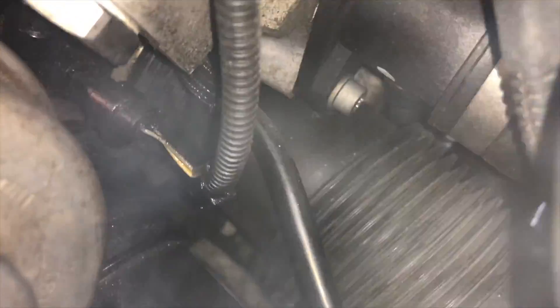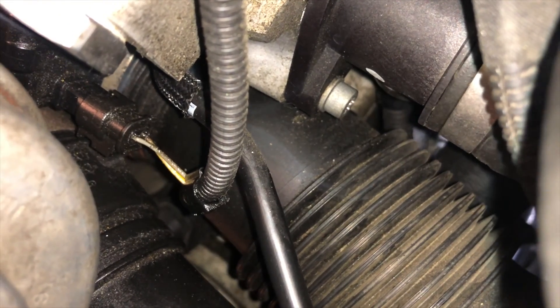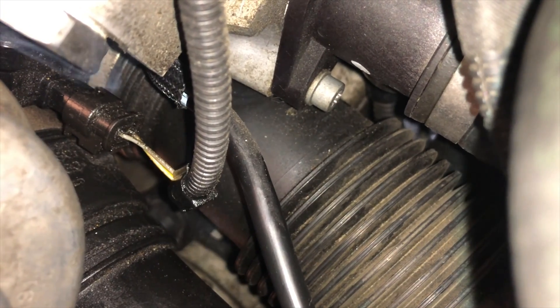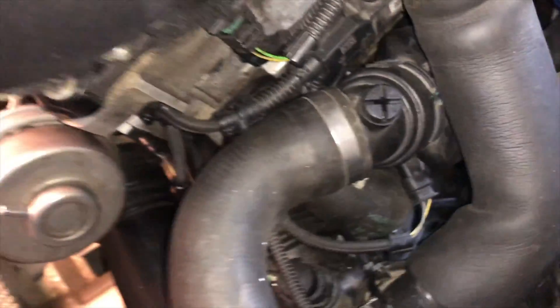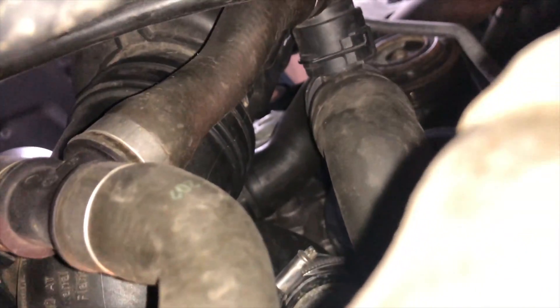I don't think it's even connected or secured with a clip. I can push it back in and it's fine. That's why these errors have been so random — when it wiggles out of the way, a lot of unmetered air gets in and the air-fuel mixture goes way too lean. Guys, there's the actual issue: I climbed under the car with good light and the air duct has actually broken off the mounting point, which is why it moves around on its own. It looks like I'm going to have to replace the entire piece, which is difficult to get to as it goes all the way around to the top.